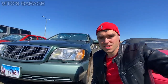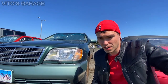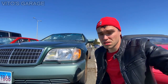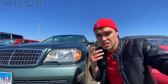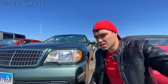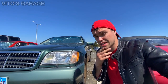As far as the suspension goes, I haven't checked too much. I haven't checked the rear suspension, but I know the axle boots are still fine — a little cracked, but fine. The front suspension is going to need new wheel bearings in the future and possibly an adjustment, because they're a little noisy and one of them is loose. I'll probably have to replace them. Other than that, everything still looks fine on the suspension — I didn't really feel much looseness in the front, which is a good sign.